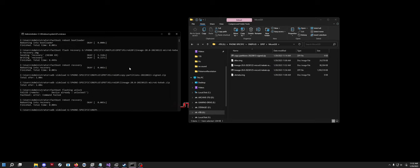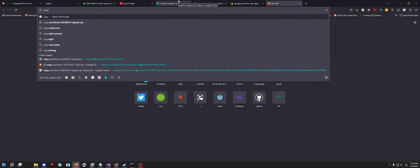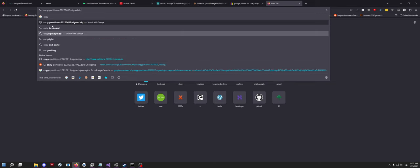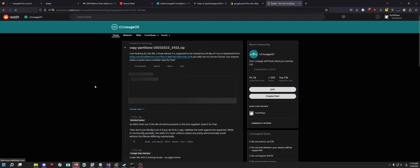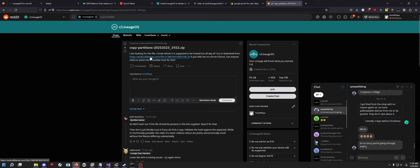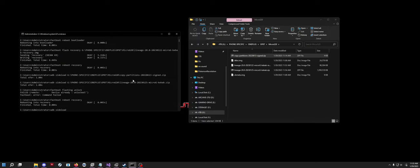I don't know the point of copy partitions, and it's a very weird thing to find, but I managed to find it just by Google searching copy partitions LineageOS OnePlus 8T. And you'll find it. So I searched basically that. I'll put this in the description because it's easier than me updating it. So I'll grab this link and hopefully remember to put it in the description. No promises. I forget things very quickly and easily. But you basically need that zip file. You ADB sideload that, then you're good to go.